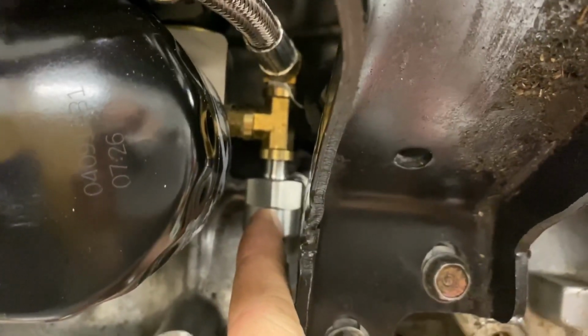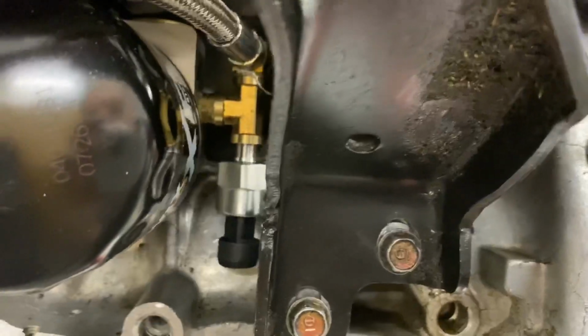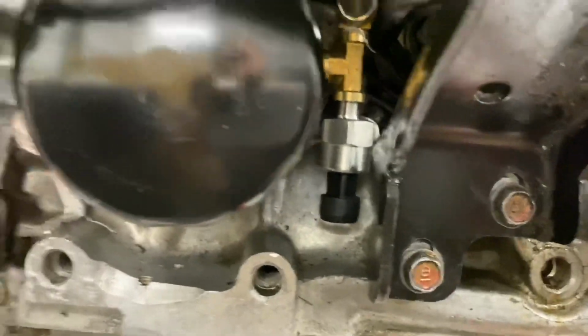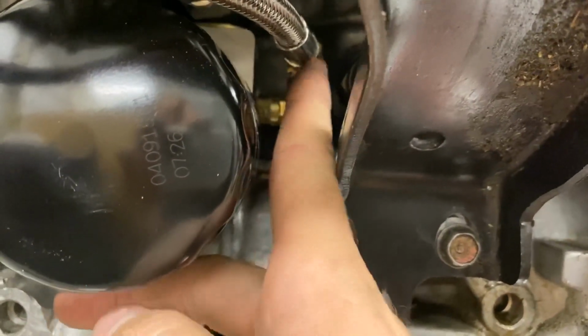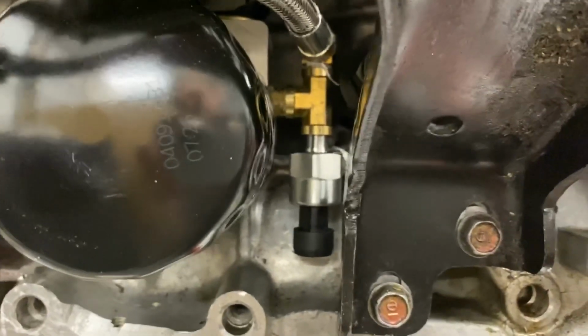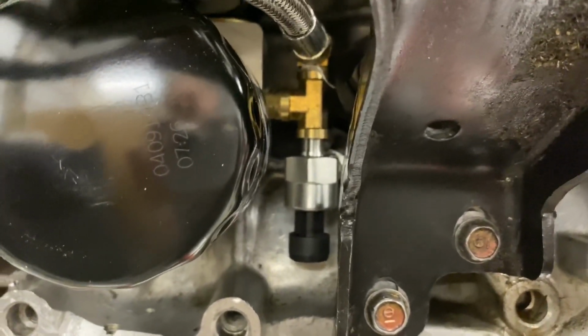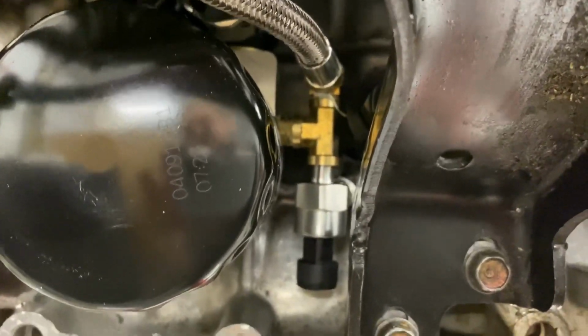This is the pressure sensor. The reason it is here, this will be around to the Honda as well. That is the worst case. That is right at, that is after the cooler. It is also right at the bleed to the turbo, and I call it a bleed because we added it. This system was never intended to supply oil to a turbo. So this is the perfect place for this. That'll be worst case oil pressure. And then on the other side will be the oil temp.